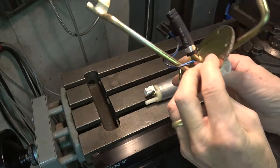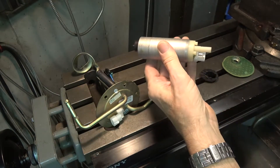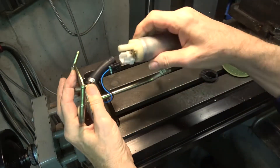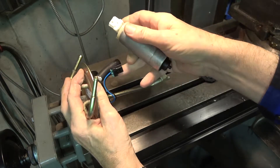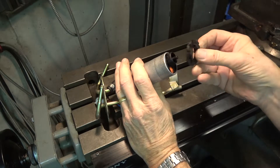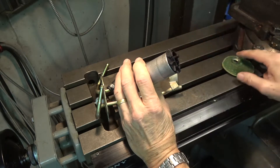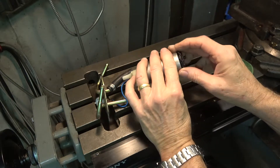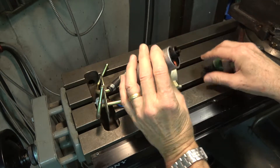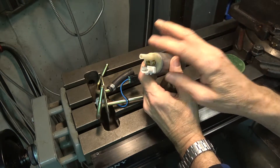I could test it without taking this apart. When I did take it apart, the pump itself is a unit like this that mounts in this frame, connects to this hose, connects to this wire jumper, and goes to the bottom of the tank. It has a rubber mount that fits over the pump, goes through this frame, and there's a filter that snaps onto the bottom of the pump. The pump sucks gasoline up through this hole and pumps it out the top.